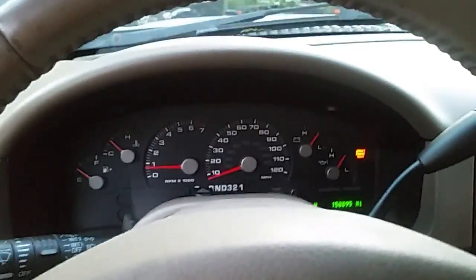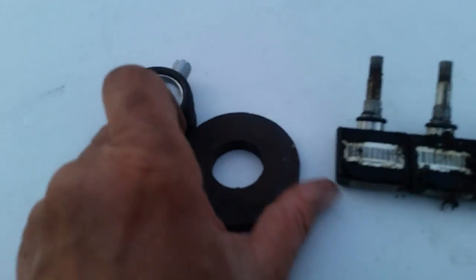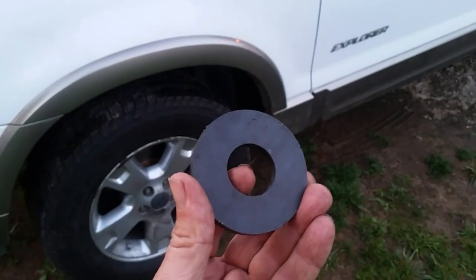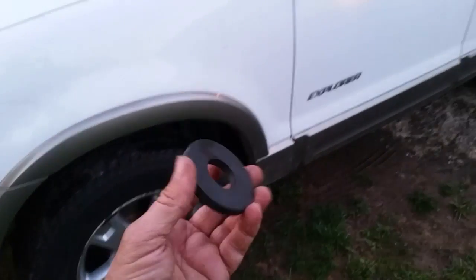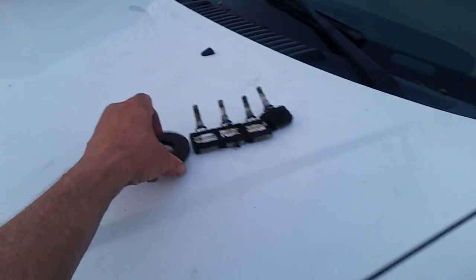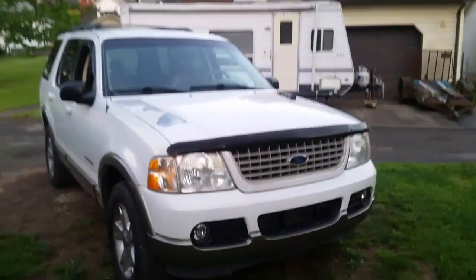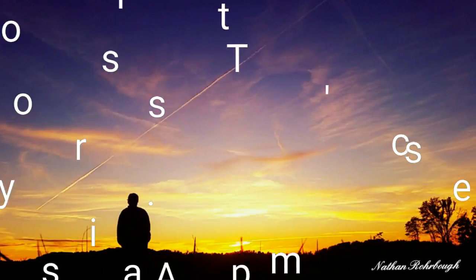Here are my old sensors. On some models of these Explorers and Mountaineers you've got to use a magnet, but most of them you just let the air out of the tire. You can also buy that $200 tool that you point at the sensor and it communicates that way. Just do some research on your own vehicle or SUV and find out what works for you. Thanks for watching — I hope this helps somebody out. If it did, give me a thumbs up and let me know where you're watching from. Until my next video, keep cool and be kind!